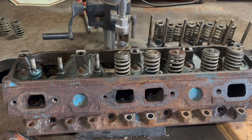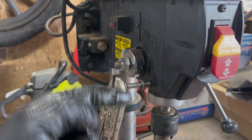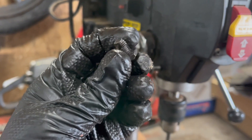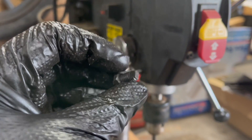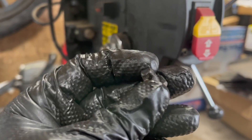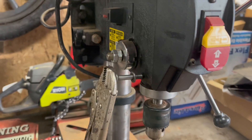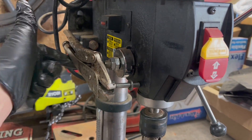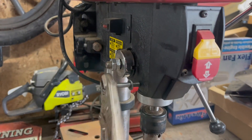In my old setup I had some little angled wedge wood block things to put under the valve to keep it from going down while you're trying to do this — a balled-up paper towel works fine. If your cheapo drill press doesn't have an adjustable spindle stop, make one. This is what was in there: an adjustable drag screw which doesn't really make sense. This is a random bolt with a little pilot point on it and it fits perfectly. Then you just use the vise grips — lock, unlock. So easy.